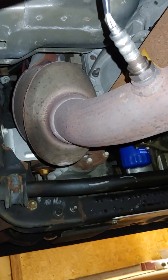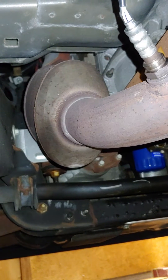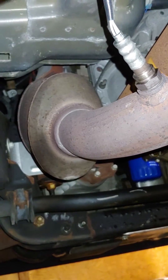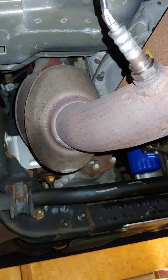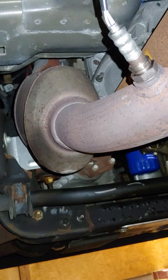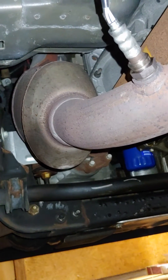Alright y'all, looking today again at the 2008 Chevrolet Silverado 5.3. This thing's gonna code me to death. I'm getting a P2270 code on the OBD scanner. In the past I've had a P2271. Both of those refer to an oxygen sensor, and luckily they both refer to the same oxygen sensor.